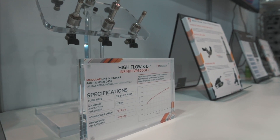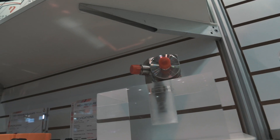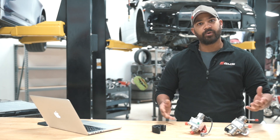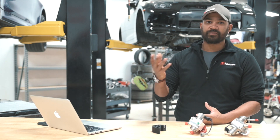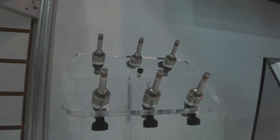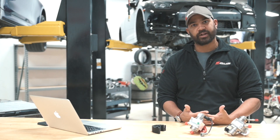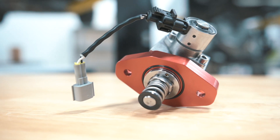Another feature is that we want to be able to flow as much fuel as we can without having large pressure increases, because most injectors won't want to run at a very high pressure. The injectors like a range more in the 180 to 210 range. This pump can run up to 250, so when injectors come along that can support that and flow a lot at that pressure, we'll be prepared for it.